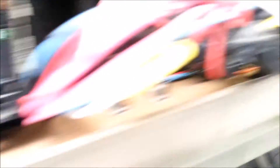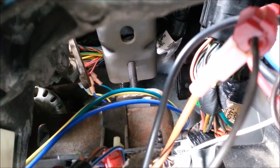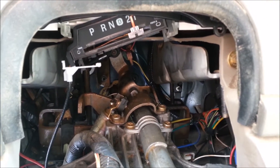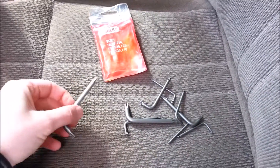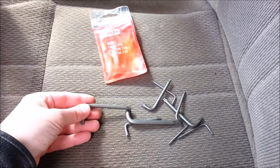You can kind of see the studs from the holes in the steering column where they line up — one way in the back, and the same on the other side. I'm going to go ahead and tighten those up. The size I need is a T30 torx, so I'll tighten up those two bolts and that should be it.